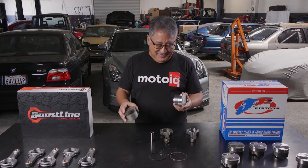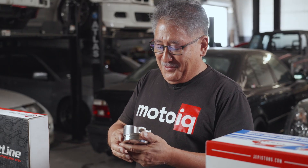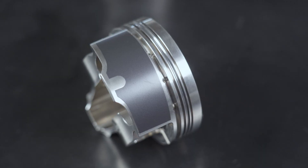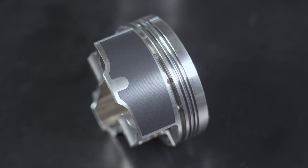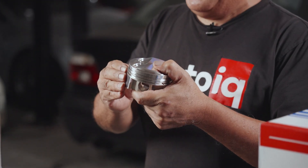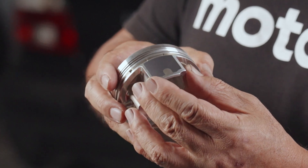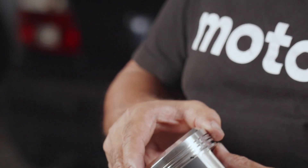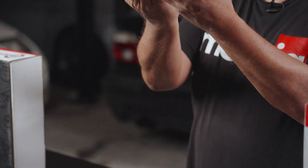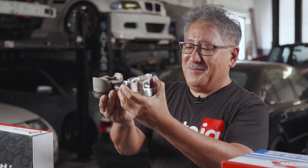So we're replacing the cast piston with the forged JE piston. This JE piston is a really nice part. It's a forging and it's asymmetrical. The cool thing about the asymmetrical piston is it has a lot more area on the thrust side of the piston — this is the part that takes the cylinder thrust load, so when the piston's coming down it pushes hard on this side. On the non-thrust side it's a lot smaller, which means the piston can be lighter and have less area for friction. When you look at the stock piston versus the JE, you can see that the skirt's been cut down quite a bit — it's almost a slipper skirt — so we're going to get rid of any excessive weight and friction right there.